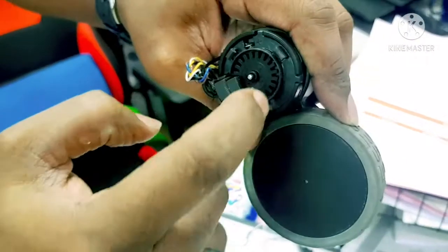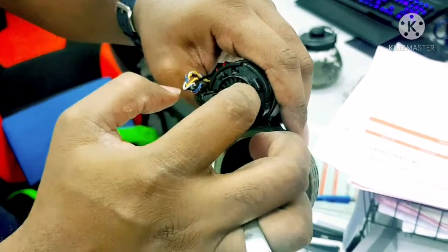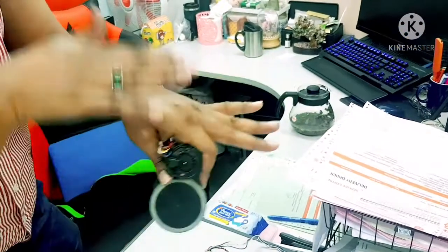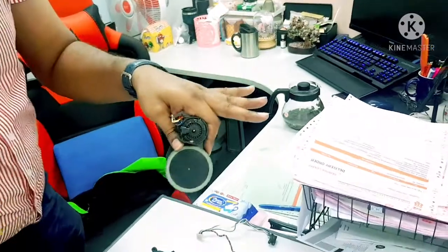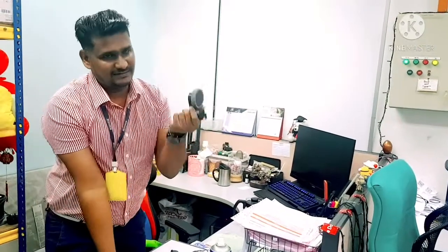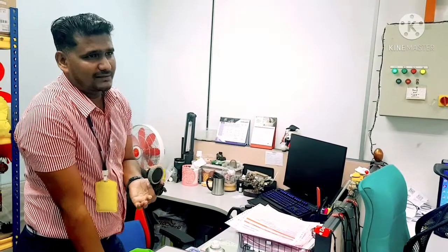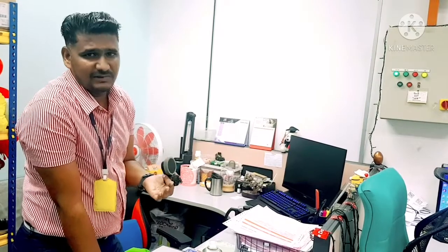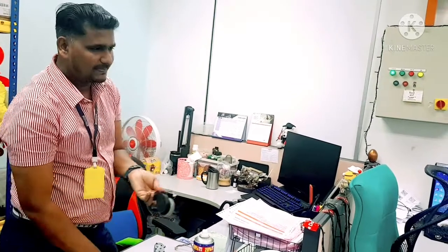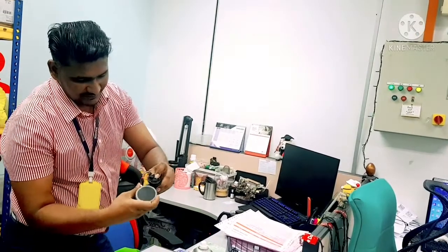When I turn the wheel you can see it turns. Sometimes this part becomes loosened — if it becomes loosened, the counter sensor won't work properly and cannot sense the exact turning rounds to send to the motherboard, so the Deebot will turn to one side very fast. If it's turning right very fast, your left side counter sensor has issues. For Slim 2, DA60, or similar models, you can check if the sensor is loosened. To fix it, remove the sensor, wrap a single layer of thread around it to tighten it, then put it back.